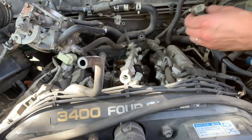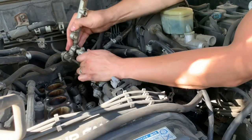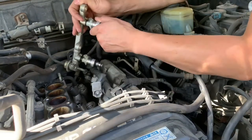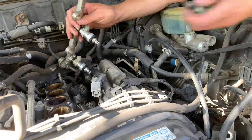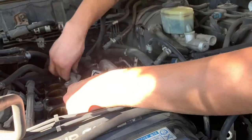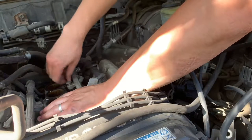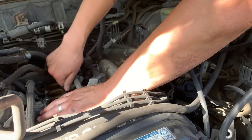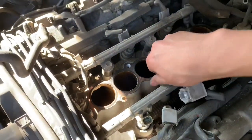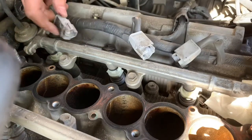I'm going for the number two injector, but I got these injectors in a pack of six so I'm just going to replace them all. New injectors going on here. Make sure you get some WD-40 or some gas on those O-rings. I had enough room with that vacuum line still attached to push that fuel rail straight in so the injectors went straight down. There shouldn't be any weird resistance when you're putting these bolts on - they should be pretty flush. If it seems like you need to force it down, you probably have an O-ring pinched.